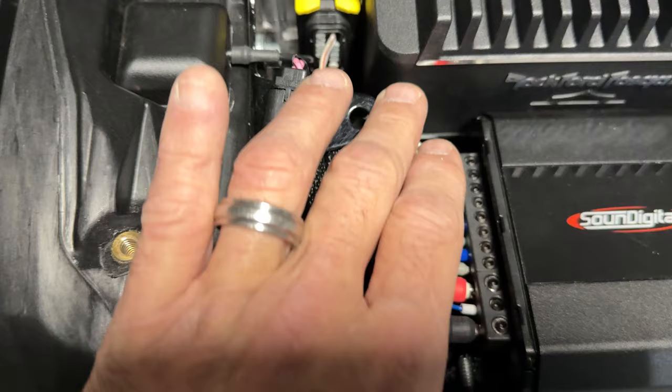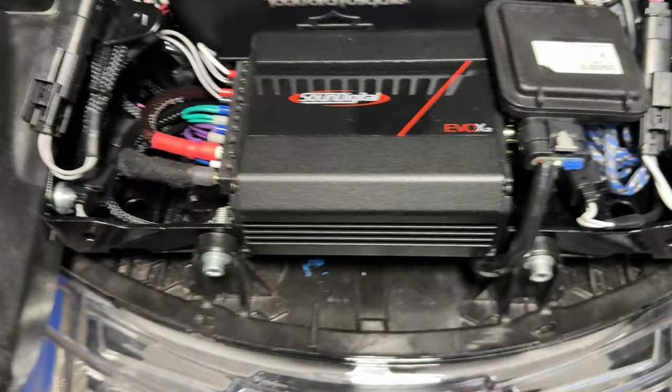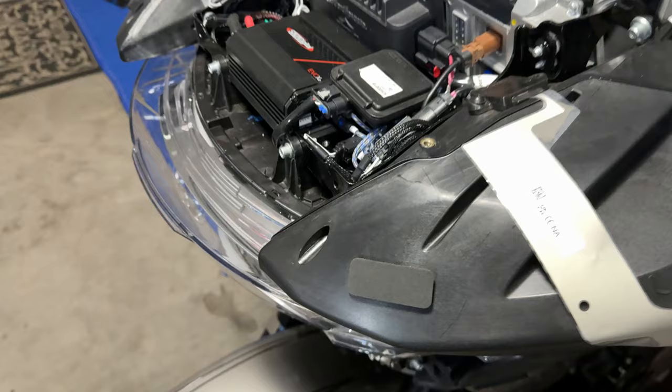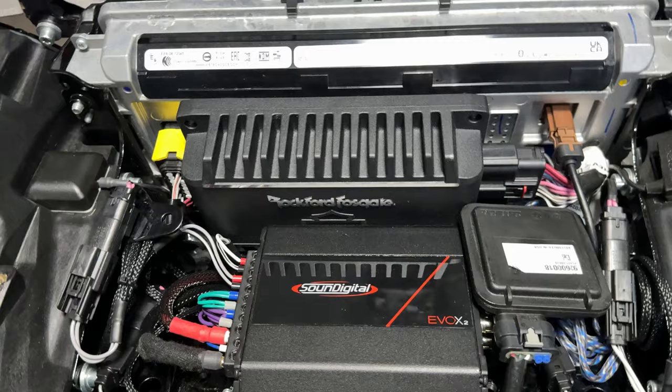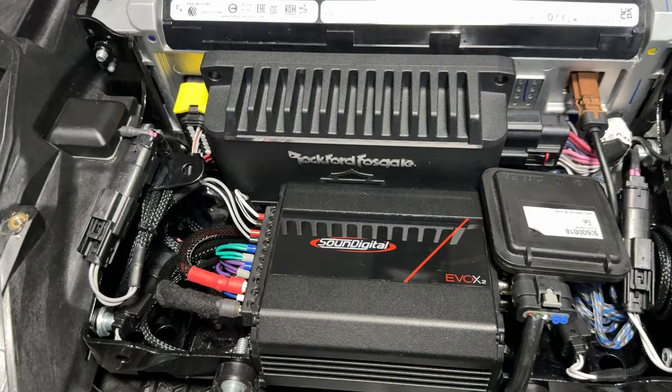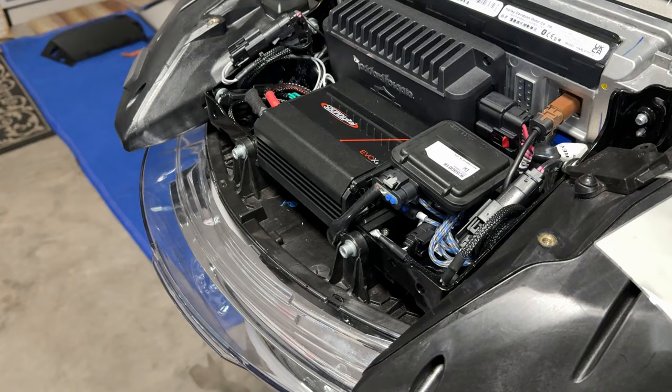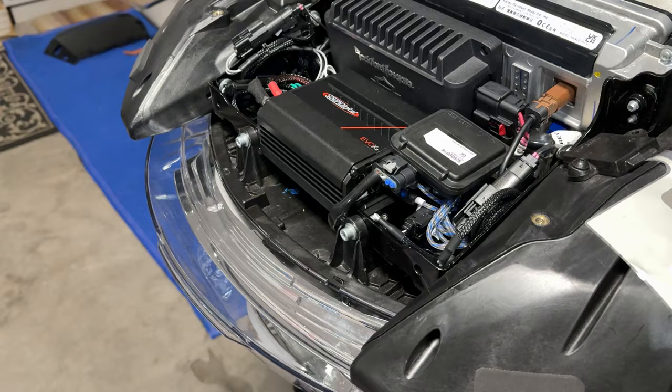It is probably one of the cleanest amp installs I've seen — no wires bundled up everywhere. It is a game changer as far as sound goes. I run it at about half volume and adjusted the gains to work with the factory radio amp. After half volume it has a program that boosts the bass, so if you adjust the gains to where half volume is close to your max, which is what Carlos told me to do, it's amazing. You don't get all that extra bass override from the factory amp.